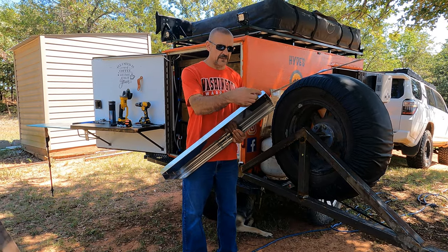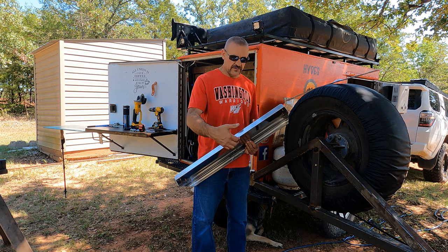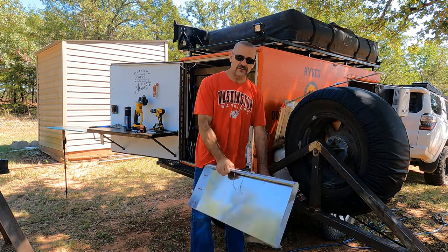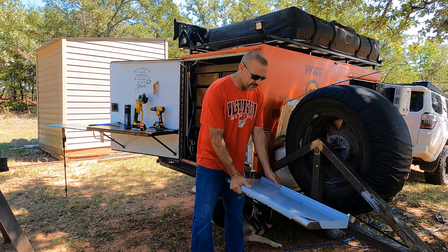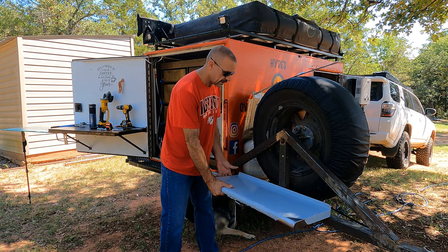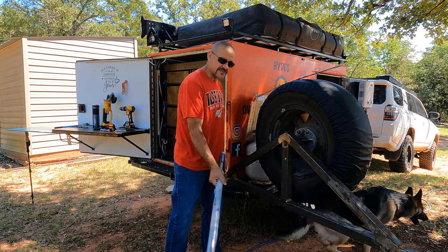It comes with a little backsplash. We don't need that. We're going to take a grinder and cut that off. We're going to take rivets and rivet the 30 inch continuous hinge on, and do the same thing to the tire carrier. And it's going to be supported with some steel cable that will anchor up here at the top. And with that same anchor point for the cable, we're going to put a pin in here that's going to hold it up. So let's get at it.